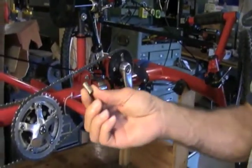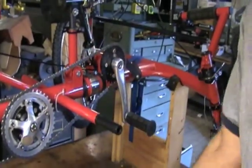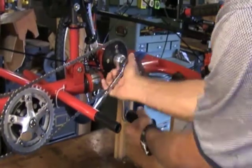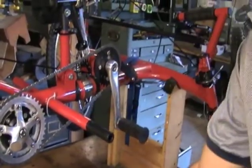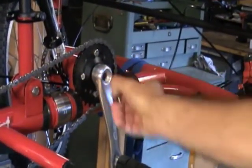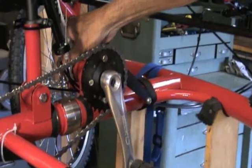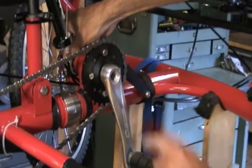Here's the third tool that comes from Schlumpf. This is to protect the threaded rod from the crank puller. If you're going to remove the cranks — this is perfectly normal, just like any bike shop would do — remove the fixing bolt. Once you have the fixing bolt out of the way, you can see the threaded rod that the push button goes on. If you just use a crank puller like this, you're pushing against the threaded rod and it could damage it.